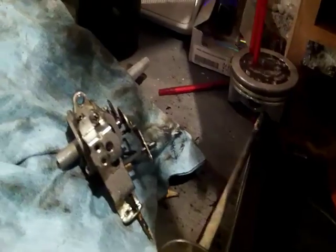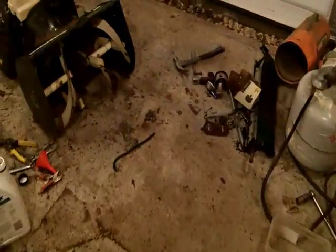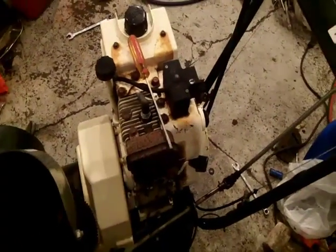I couldn't believe it. Spent pretty much all day working on that thing, and I was on it for about another hour trying to figure it out. I even replaced the fuel line. I redid even the needle and seat, thinking it was that. I thought it was the float. Put a brand new float on it, and I just couldn't get it. So then I was like, all right, what the hell's going on? So then I took out a magnifying glass. I'm looking all over, even popped off a little aluminum cover there, and couldn't find it. And then I'm looking at the light, and there was a small little crack in it. So that kind of sucked. So my boss has that carburetor right now. I guess he's gonna try and match one up with another one. I wasn't gonna give him the one off of this one, that's for damn sure.